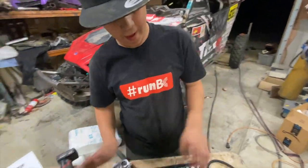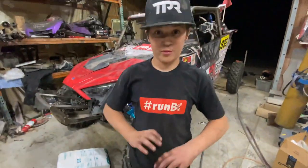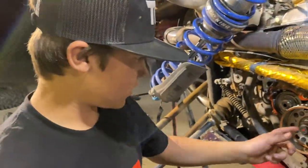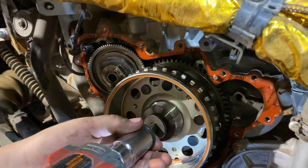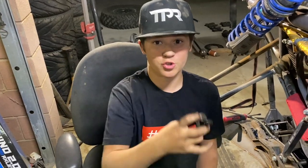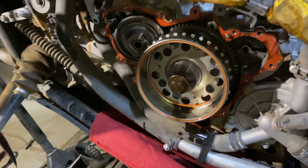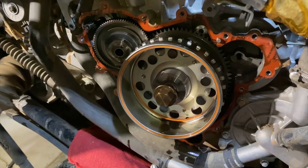You can see all the access you need to reach your eight millimeter bolts on the side right there to mount it right onto the cover. Now let's remove that bolt from the flywheel — instead of this we're going to get a 22 millimeter and drill that right out. For the ZRP you don't actually need to reuse your washer, just bolt it straight in. You're going to first torque it to 100 pounds of torque, then loosen it and re-torque it to 133 pounds of torque.